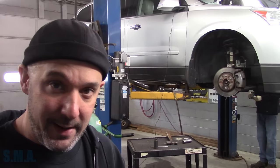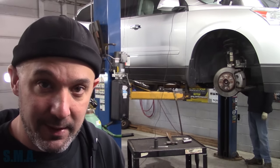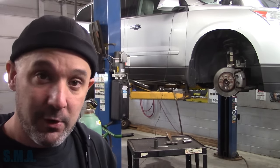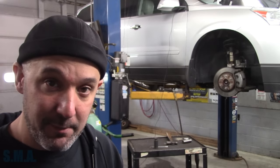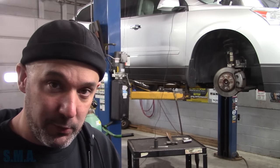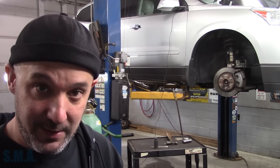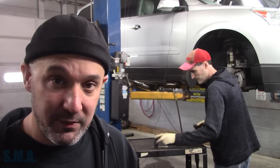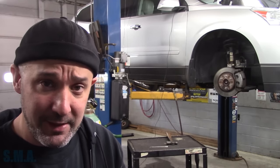Look at your wear pattern. I think on that one, the heel-toe wear, drive side versus coast side, indicated that we had some pinion depth adjustments that could have been made, but we were able to increase the backlash and get our wear pattern where it looked nice. But the good news is it's in, it works, it's quiet, so everybody should be happy.